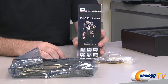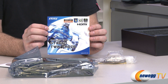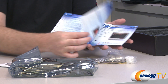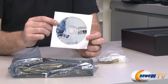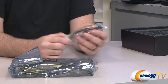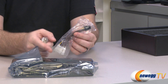Here's a quick look at the accessories in the box. There's a quick user's guide from MSI if you've never installed a video card before — you can also check out our how-to-build-a-computer video series on Newegg TV. There's a specific guide for the 660 TwinFrozer Edition covering card features, layout, quick installation, and tips on using the Afterburner software. It's best to download the latest drivers from the NVIDIA website. You also get a power adapter — two Molex plugs to a six-pin PCI Express connector, which is the only power connector required for the card.